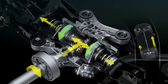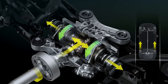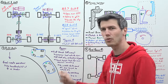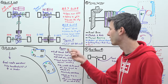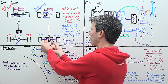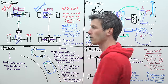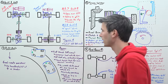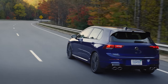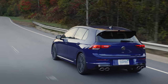This makes it a much better system for torque vectoring, allowing better handling and performance out of corners. Another clever application, used in the Tiguan R in other markets, is locking up both clutch packs fully in off-road mode so it acts like a locked differential — both tires always rotate at the same speed. That off-road mode isn't included on the Golf R since it's designed for road use.